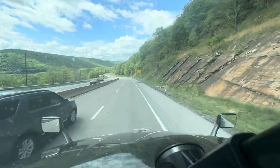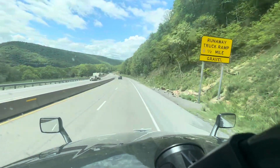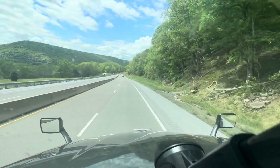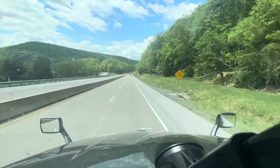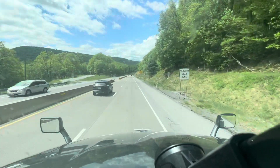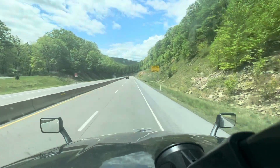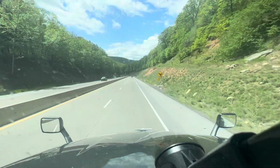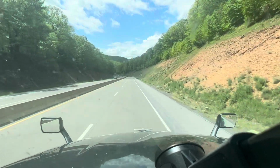I might have to use the brakes. RPMs are getting a little higher than I like for them to get up to. But you just kind of pump them a little bit. You do a quick little jab at the brake, and then you let go and you do another quick little jab. You do not hold the brake pedal down. That may have been the only brake applications that I have to perform on this hill, even at this weight.